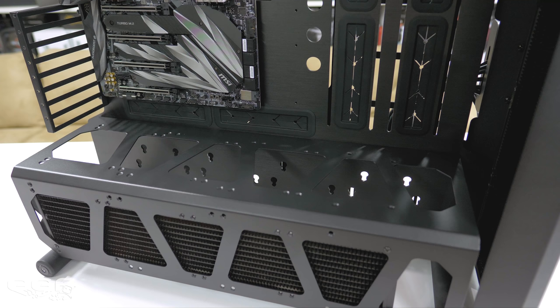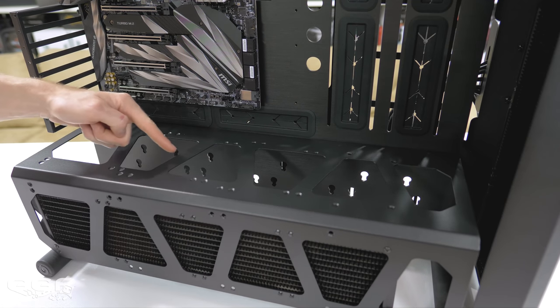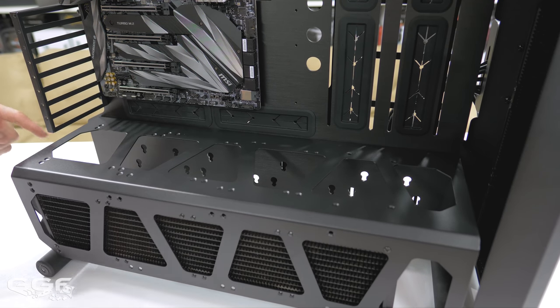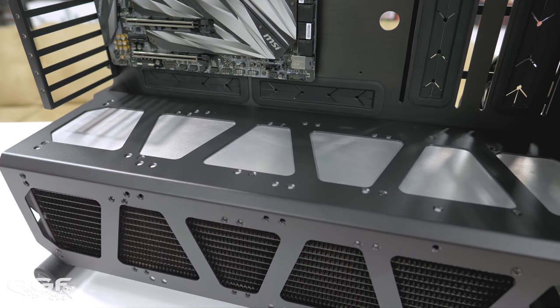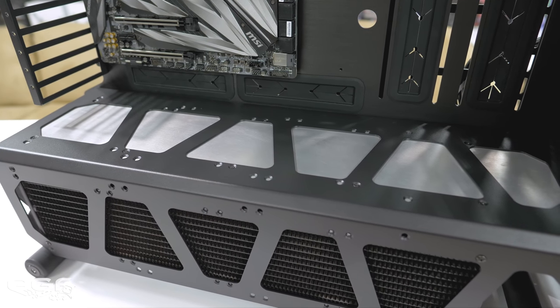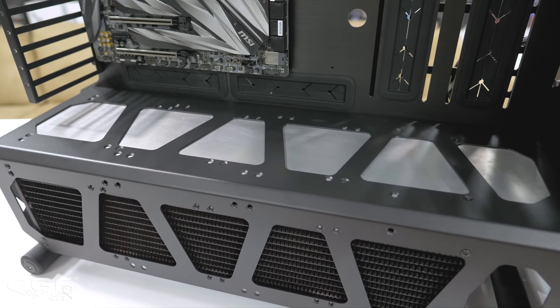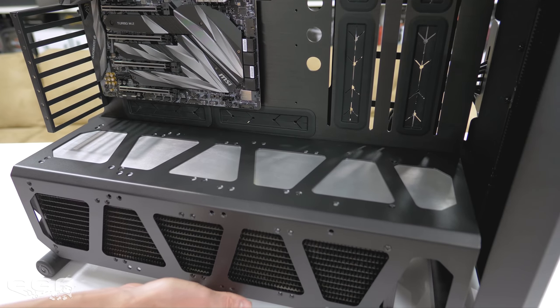This is due to the spots highlighted in red being the only support hold in this bracket. The bracket wasn't sagging where it mounted to the chassis, but was more bending on these 7 weak spots. I guess the only way for Raijintek to overcome this is to use thicker material. I managed to fix this myself by adding a thick 3mm aluminium backplate to this whole area. I was actually going to do this anyway, as I didn't want my side radiator blowing hot air up into my motherboard area, and secondly, I wanted to add some contrast to this area. By adding this brace, it really strengthened up this bracket.